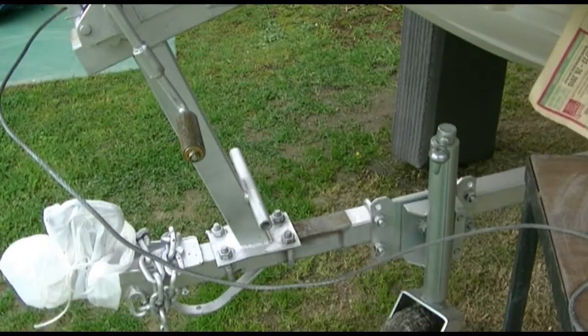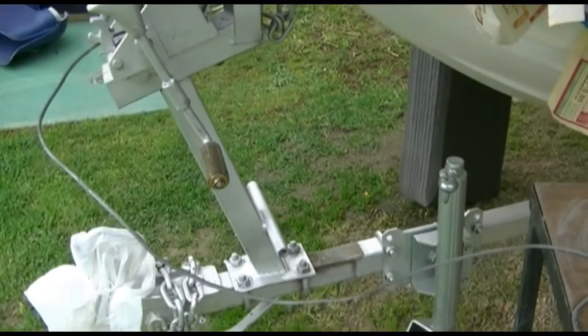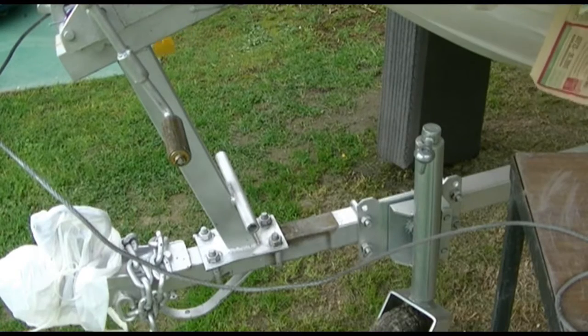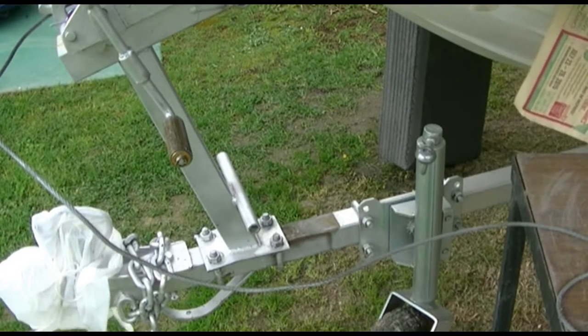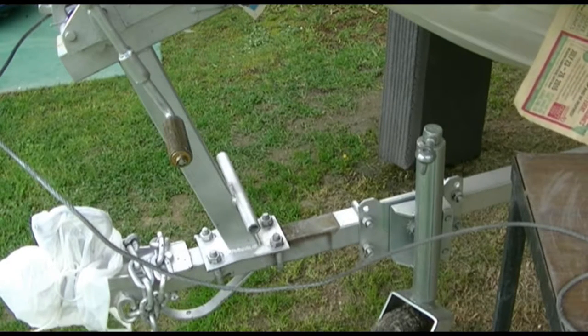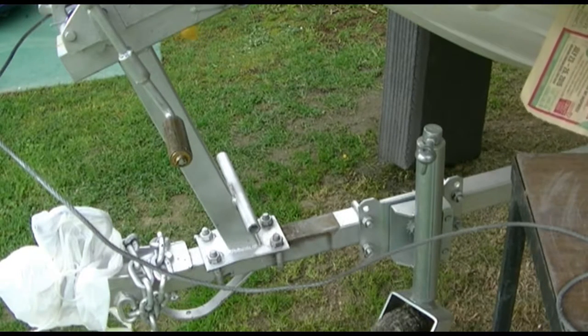Just to refresh our memory, I had to move the stanchion forward to pull the boat further up because the new heavy motor made the front so light you could lift it with your little finger. I've moved it about 4 inches and that gives it maybe another 40kg. I think the limit on the tow ball is 50kg.